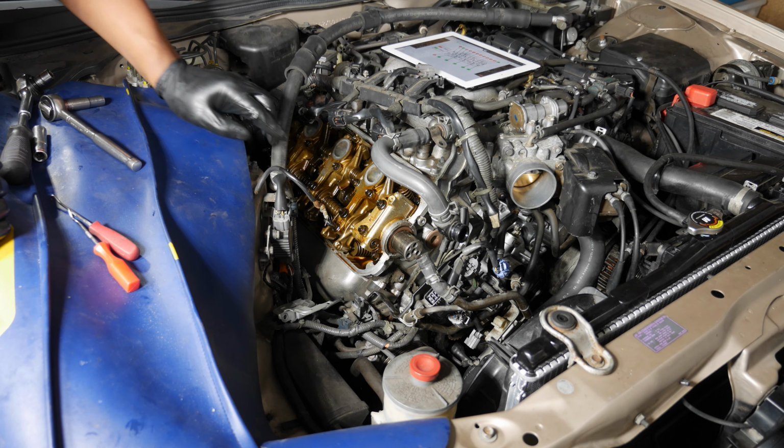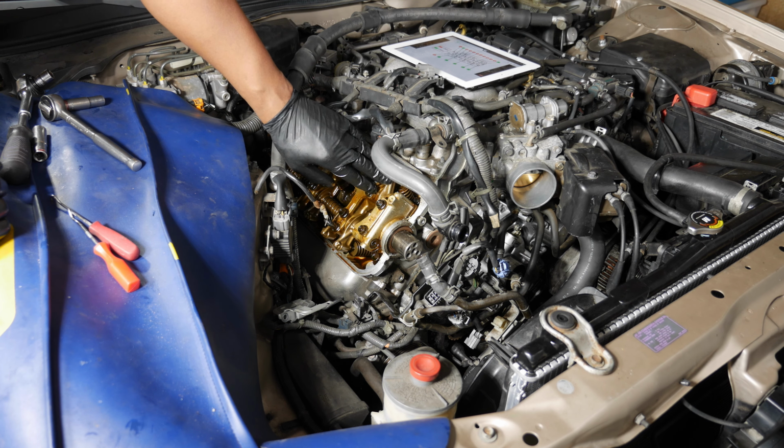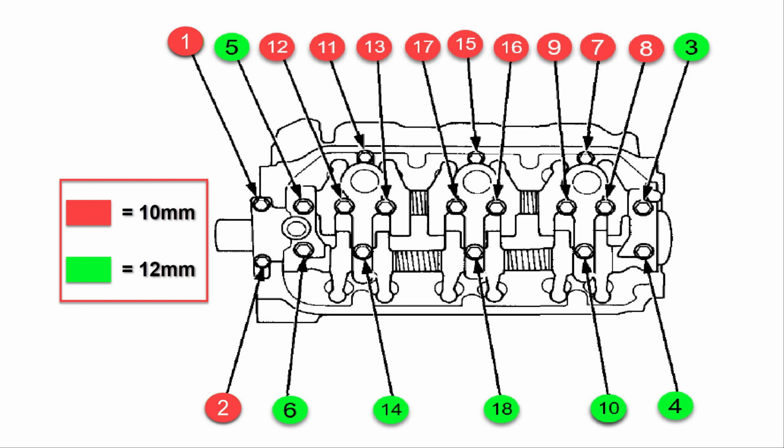Alright, so I have loosened some of the bolts for the rocker assembly. I thought I'd throw this valve train loosening sequence in here from the rear cam plug replacement video. Again, check out that video for full context. The bolts should be loosened in 2-turn increments.